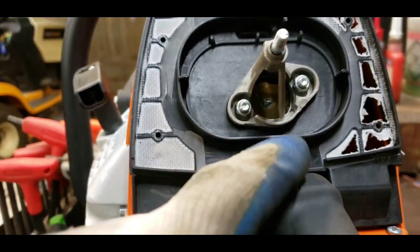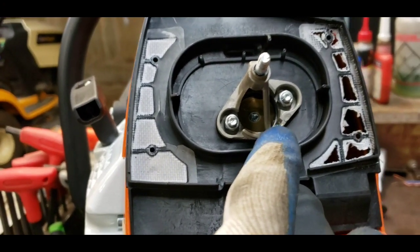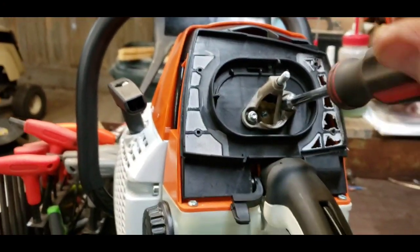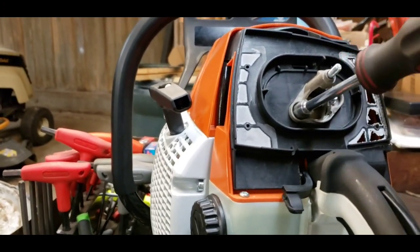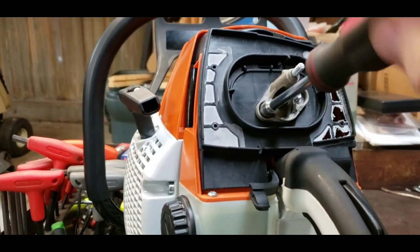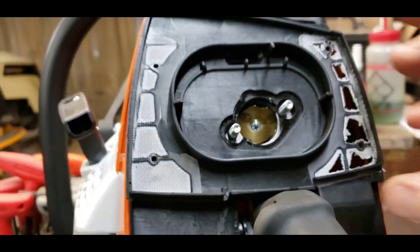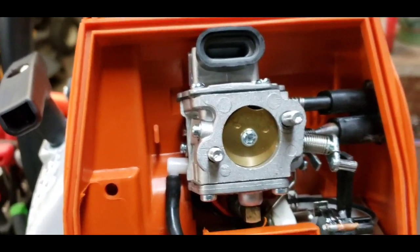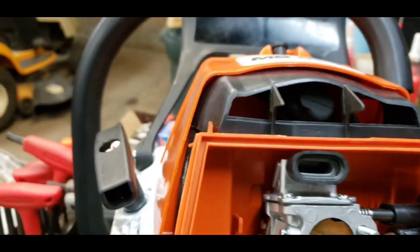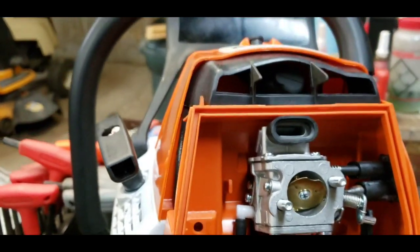So I don't know what's going on here. Like I said, I just figured this out. But this is another issue that's happening with these Chinese clones. So if you put one together and you go to start it and you just pull and pull and pull and it acts like it's not choking, you need to take this off. See — with that off, I can just push that lever down, the on/off choke selector lever, and that'll close right up. But this black plastic backing plate is hitting this arm and forcing that choke open. So there's your tip of the day, guys.